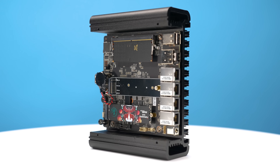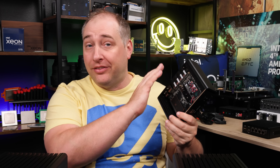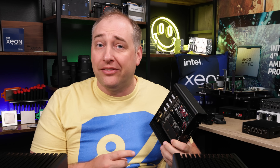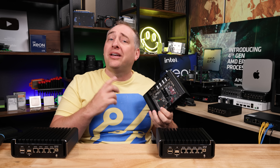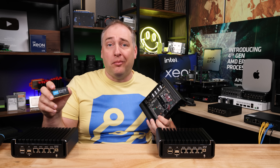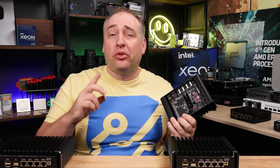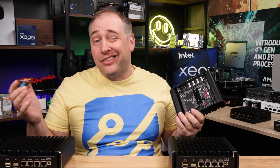Inside the system you'll see some new and some old stuff. On this side we have our memory and our NVMe SSD. Starting with memory: in the previous generations we had two DDR4 DIMM slots, but in this generation the N100, N200, and N305 are all single-channel memory, so we only need one DIMM. We're also moving from DDR4 to DDR5, which gives us more performance from that single DIMM — and since many people were already running one DIMM anyway, getting about 50% more memory bandwidth from DDR5 is a good thing.